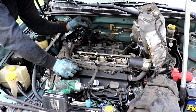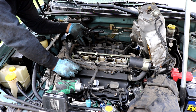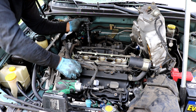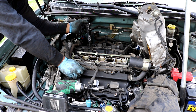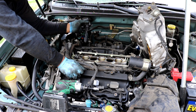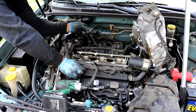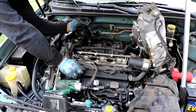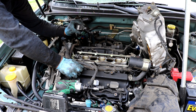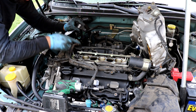Right now, inspect to see if there's any oil on these boots and down in the spark plug holes. If there is, unfortunately Nissan decided not to make the spark plug grommets serviceable. There is a seal around each spark plug hole — people have cut them open and rigged something up, but really you're supposed to replace the entire valve cover. If you do have oil on them, you'll want to get new valve covers. All these look pretty dry, so I'm happy with that.